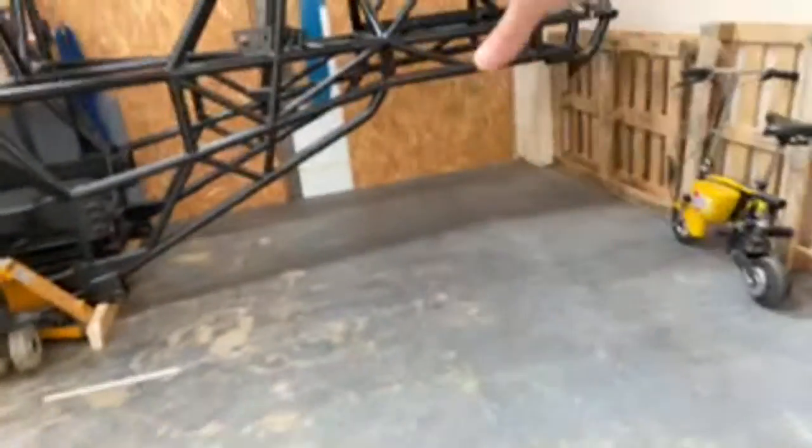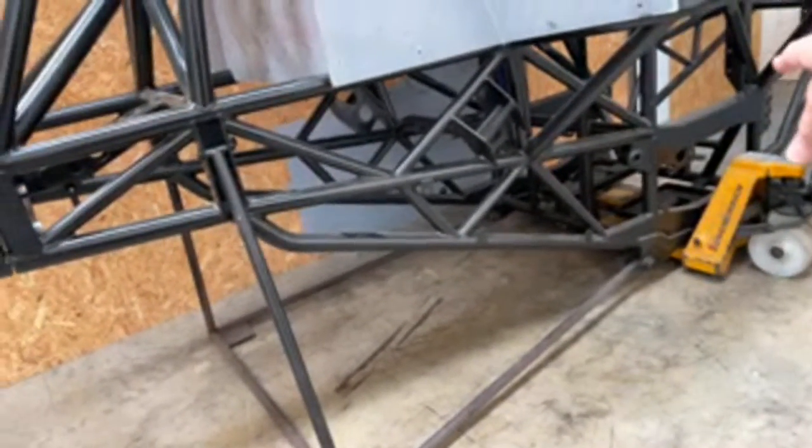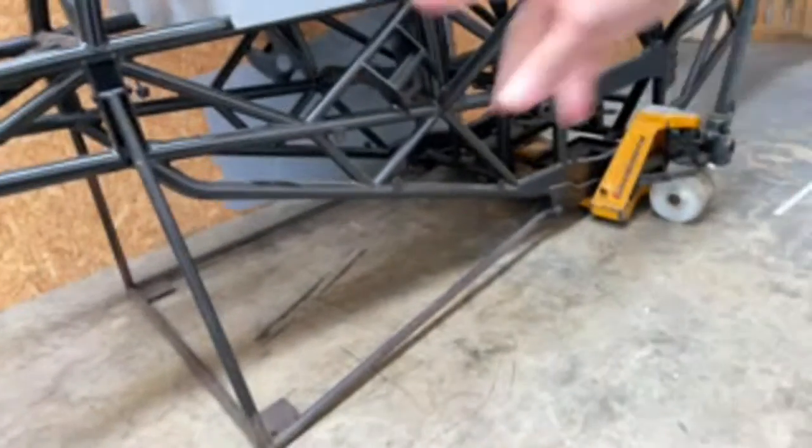So we're going to put the axle there, then wheel it out and get the chassis sort of in the middle. Axle on. Then I'm thinking get the transfer case on while all the 4-link bars are off, because it's quite easy to get in there at the moment. Get the shaft in there, and there's a shaft that goes through the middle, and another bearing thing that clamps on there. Then we'll get the front axle bolted on, get the shocks on there and everything, and get all the 4-link bars on.